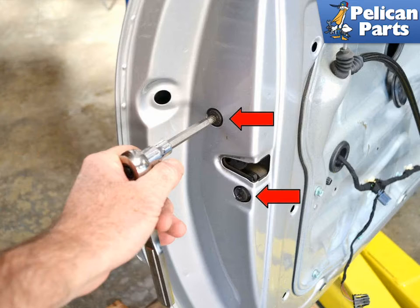After removing the exterior door handle and cable attached to it, remove the two bolts holding the lock assembly to the door (red arrows). On our car they were eight millimeter triple squares, but your door may be different. Only remove these if the lock is still attached to the inner panel; otherwise wait until the panel is removed, then remove the bolts.